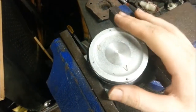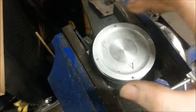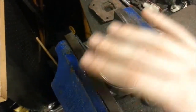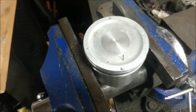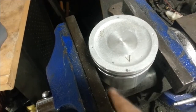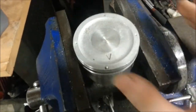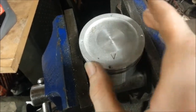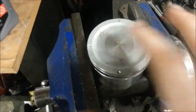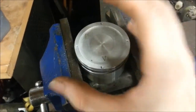It forces a seal. Now it may shorten the lifespan of your engine because it's pushing the rings out and rubbing harder against the cylinder wall, but you'll get all the power you can get and you won't have that blow-by problem anymore. If you still have blow-by, gas port it some more — not just four holes. With my 380 cam, I'll probably do eight instead of four.